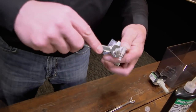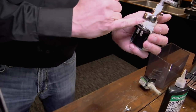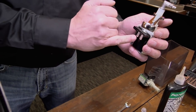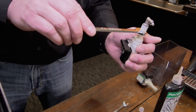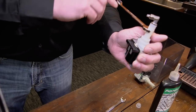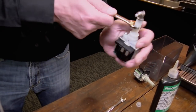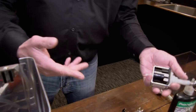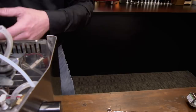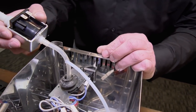One thing also — the elbow position needs to be facing the same direction as the wire connectors, because that's the way it was when it was in the machine. So we're just going to grab the neck and turn it so that the elbow is facing the same way as the wire connectors. Now it will be lined up when we go to put it in the machine and the holes will screw back on no problem. Now we can replace the pump by adding the tubing back on there.